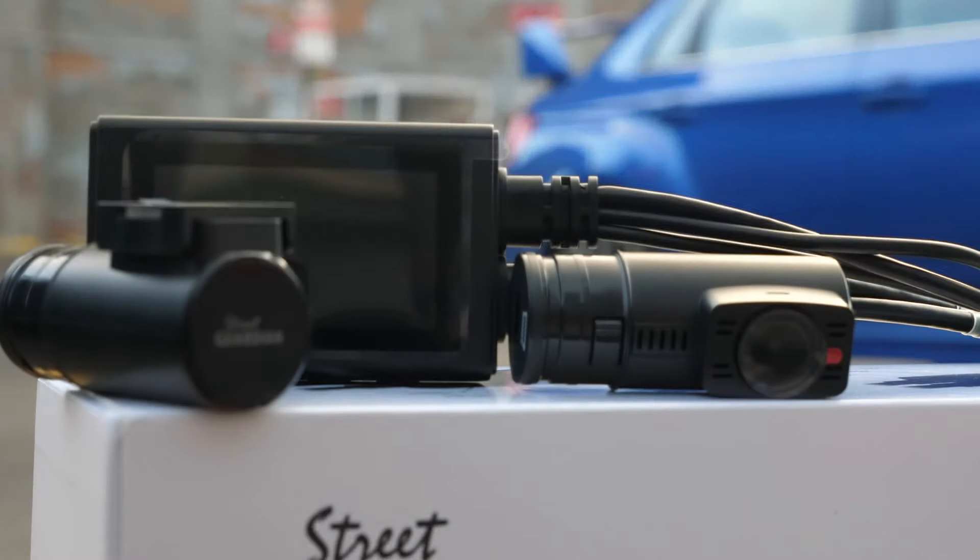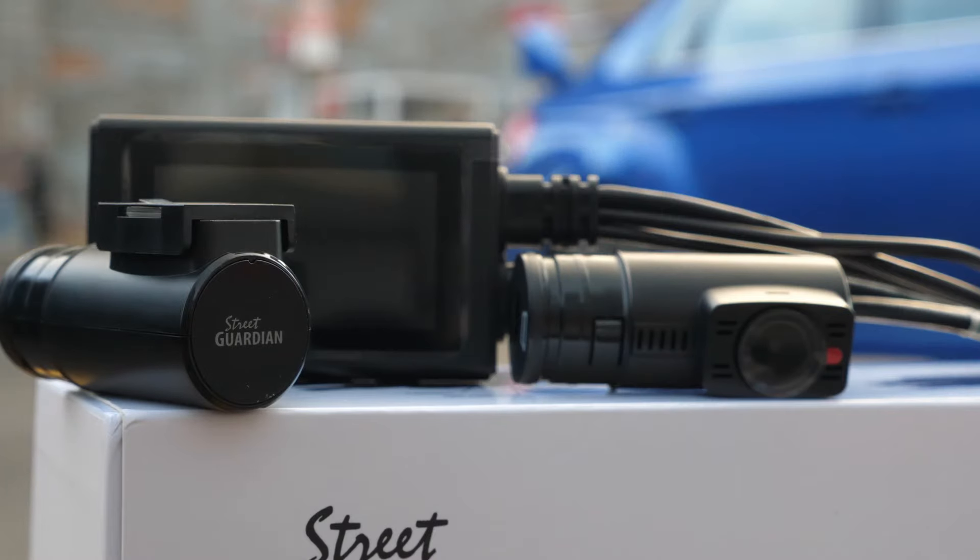And this is where the 3DR's parking mode comes in. The parking mode keeps your dash cam rolling while your very nice vehicle is parked and the ignition is off, so if someone messes with your ride while it's parked, this dash cam will catch them in the act — and they won't even see the tiny cameras. The 3DR's parking mode comes with four options. The 30 fps mode captures regular video motion and audio while you're parked. The other 1, 2, and 5 fps modes take regular snapshots and combine them into a time-lapse style video that doesn't include audio. I'd recommend just using the 30 fps mode, because the lower fps modes are only useful if you're using a lower capacity micro SD card. As you can see in the sample parking mode footage, the image quality is nice and clear no matter which mode you end up using.